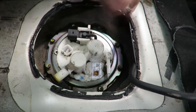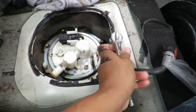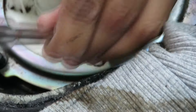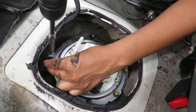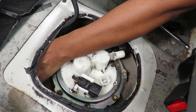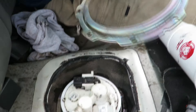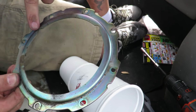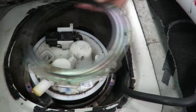Next step is to take all the bolts out — break them all free first and then I'll show you a quicker way. After you get the bolts out, take the ring out. When you put it back on, there's a groove here and a groove here, so it only goes on one certain way.